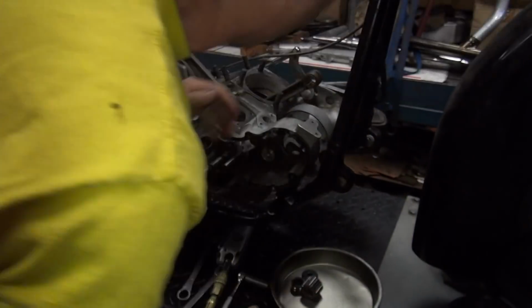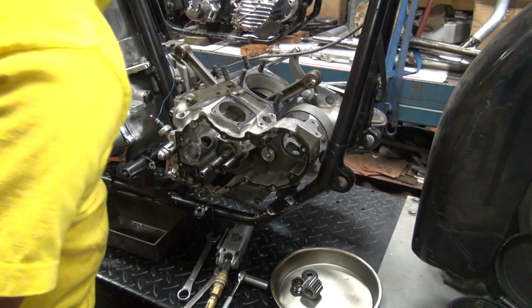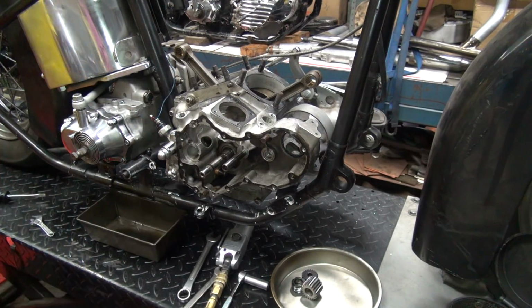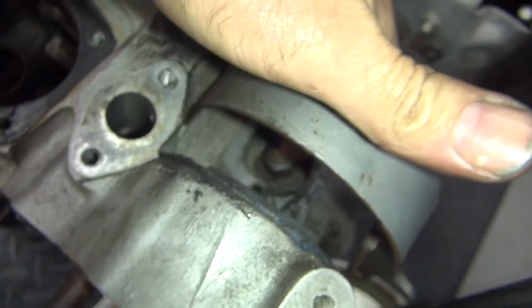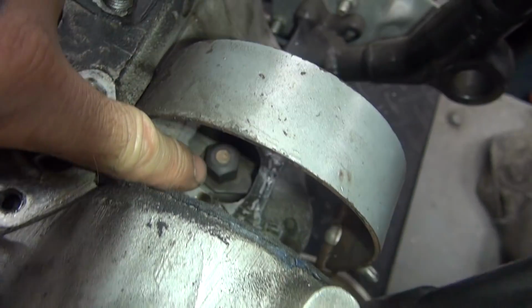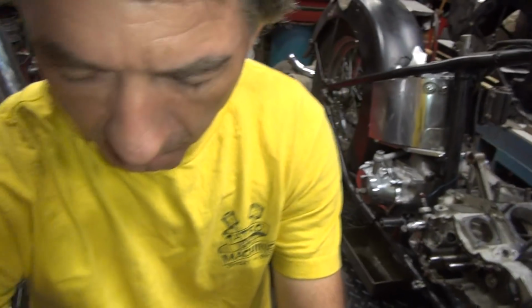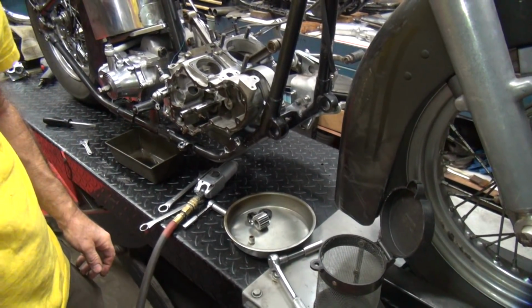There's a big straight slot screw in there. Alright, looks like it has the factory nut under there. It takes a straight 9/16 socket. So some panheads, all these generator mounts, have a special encapsulated nut down there. It's got a little finger that sticks out so it won't rotate, so that's just a nut. Bolt comes from the bottom. Pretty straightforward design.